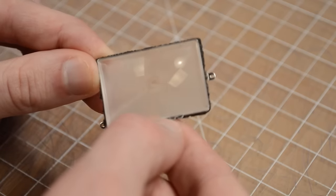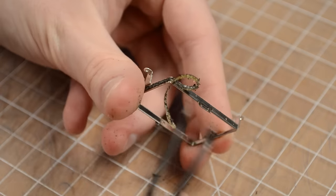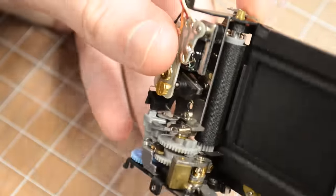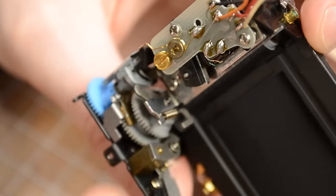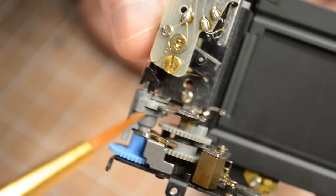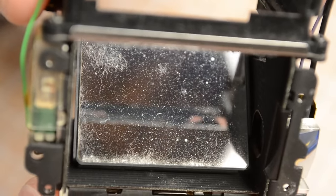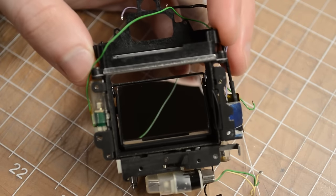The cleaning is really not that interesting, so I'm going to gloss over most of it, but I will show you the lubing because everyone likes a little bit of lubing, and there are a lot of lubrication points that need to be gone over in these things. Essentially, what you want to do is apply grease to all of the friction-based latch points, and you want to apply oil to the little pivot points. You don't really want to put too much on — just enough to keep things gliding smoothly without gumming up the internal components. Any amount of dirt that gets within the camera is going to stick immediately to the grease and oil. Our mirror is looking more like a petri dish than a mirror, so we're going to wipe that clean with a bit of hydrogen peroxide and a clean microfiber cloth to get it looking pristine once again.